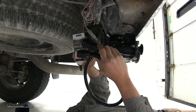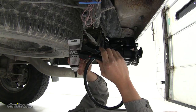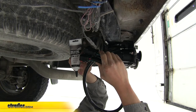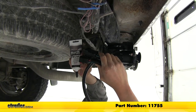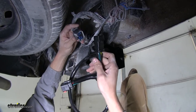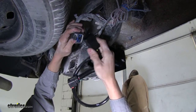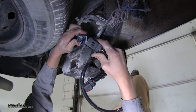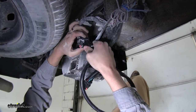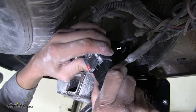Now we're ready to bring in our connections. When making electrical connections, it can be helpful to use dielectric grease. This can prevent moisture from getting inside your connections, keeping out rust and corrosion. You can pick some up at eTrailer.com with part number 11755. We'll take our factory connection that we disconnected — we want to make sure that the red tab is pulled outward. Then we'll take our easy connector, push it all the way in. Once we're sure that it's all the way in, we can go ahead and replace our red tab. Then we can pull outward to make sure it's connected.